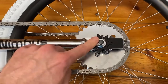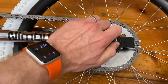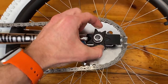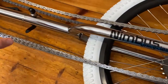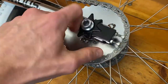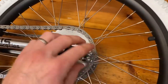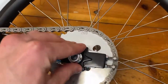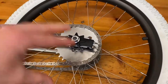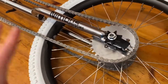This isn't tight at the moment - it's just for demonstration purposes - but if I had the pedal spanner and started to loosen this bolt off and wind it all the way out, I can then pull up on this chain tensioner and it pops out of the frame. You saw the chain go loose, but this chain tensioner is still exactly set in the same place. So I could wind this all the way off, take this off, strip the giraffe apart, and when I come back to put it back together, these are still set as they were. I would simply push this back into the frame and tighten that bolt up.